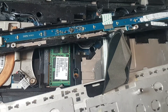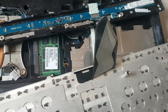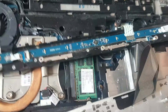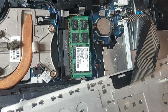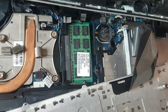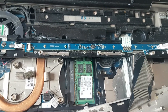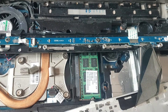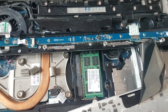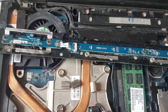So don't be scared. Take the cable out and learn how to reinsert the flexible cable back into the ZIF sockets. There's another little ZIF socket here as well. The two tabs on the side you lift up and you slide out the ZIF cable — ZIF means zero insertion force. So there's no poking and tweaking and soldering and generally messing it up. Just lift up the two little tabs and that's it. Remove the cable.